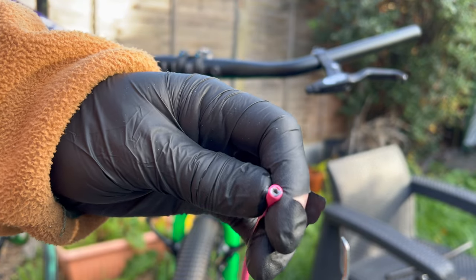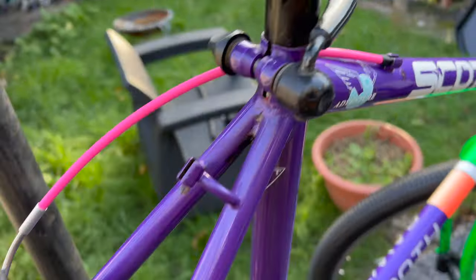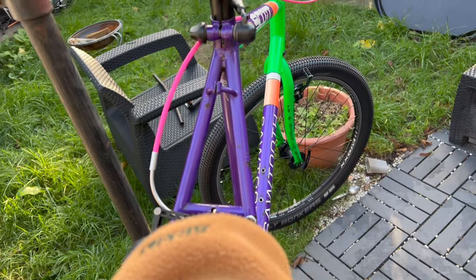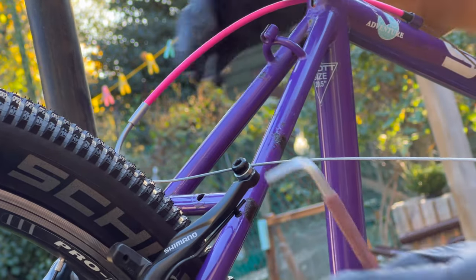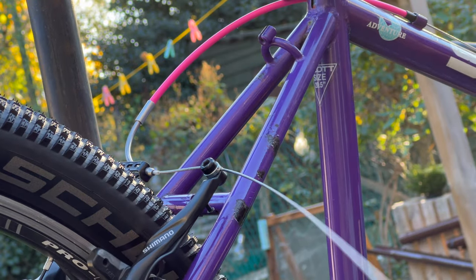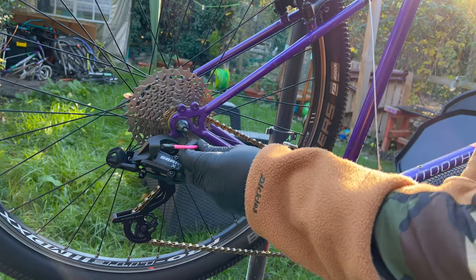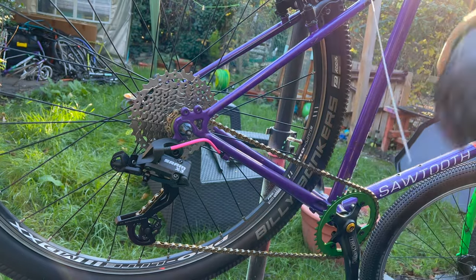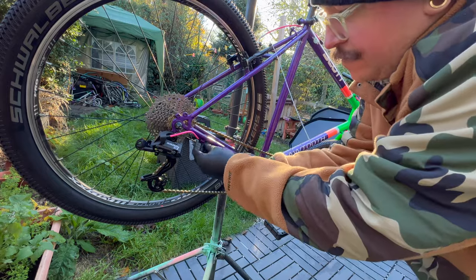Pro tip: for the little plastic tubing inside, use a small pick to make sure it's nice and open so it doesn't wear out the cables — and I ripped the glove. This cable I wasn't 100% sure was going to be okay because it's meant to go on the drive side when it was cantilevers, but after I put the cable in the movement was quite smooth — it didn't feel like it was rubbing or pulling too much, so I think I got away with it. When I put this derailleur on the Mirage some people said the cable was too short and needed to be bent more. Looking at the manufacturer guides for this derailleur, it doesn't want it to be too short, and when you move the derailleur around it seems pretty solid, so I think it's fine.